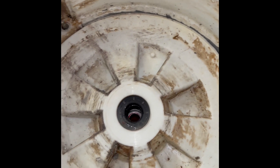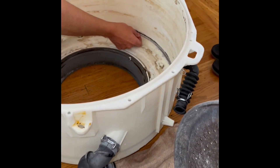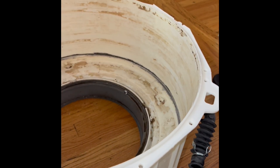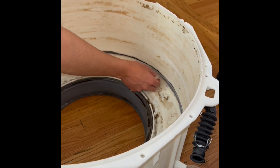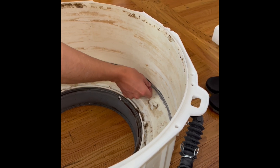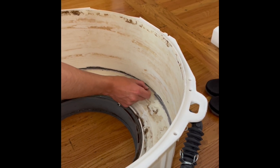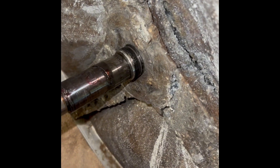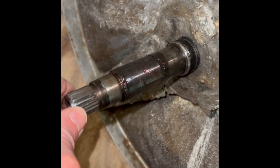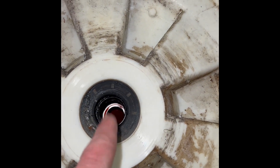With the two halves separated, there's some damage to the interior front of the tub. We're going to clean it up and apply epoxy to seal a couple of leaks. The leaks were caused by the edge of the basket spinning against the plastic after the spider bracket broke. The rear bearing was fully intact with no leak — it was doing great.